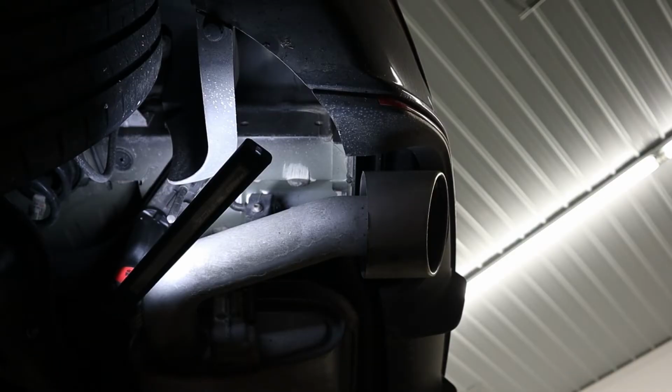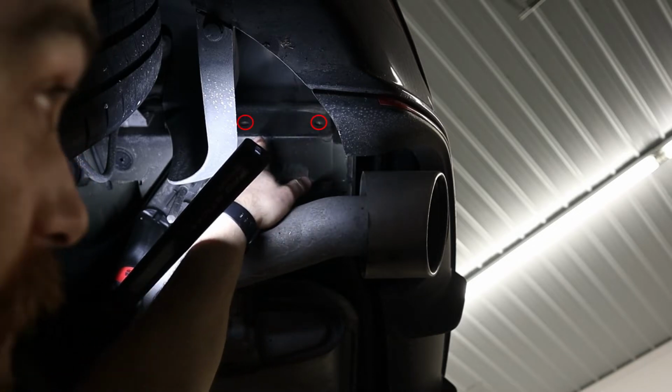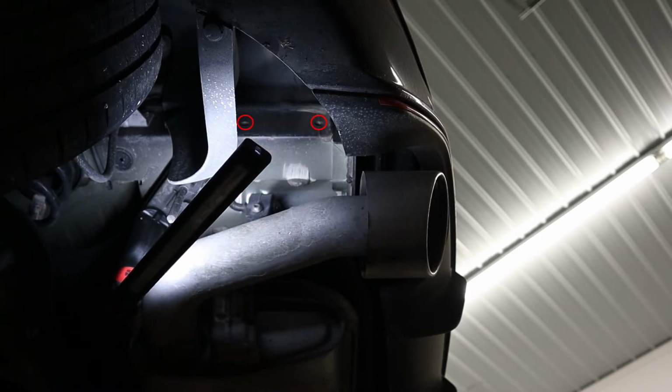So this is the side bracket. These are the two holes right there. There's another one right there. Those are the holes that you may have to chase. It's up to you guys. You can either ram the bolt in or chase them. Obviously the safer route is to probably chase the bolts. They are M10 by 1.25. So if you use a tap, M10 by 1.25. We're gonna do that right now.